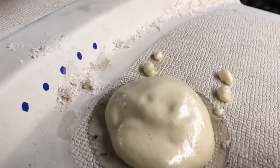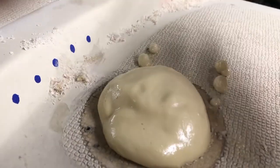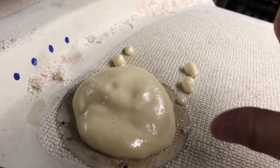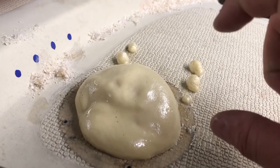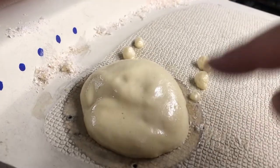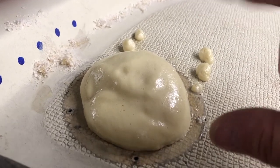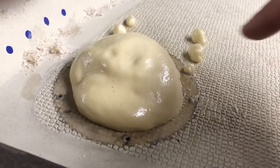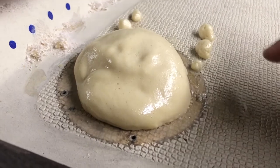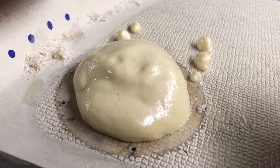And then over here, I just poured the rest in, filling all this gap here. So this should all be pretty solid when it all hardens up. And then when I put my clutch there and my backer plate on the other side and clamp down, it's not going to be clamping over a hollow space. It's now going to have this, which should be pretty hard foam that's supposed to withstand, you know, 100 pounds a square inch. If you look at this area, we're looking at like 6 inches or so, maybe more than that once you have the backer plate on the backside. So I think it's going to do its job.